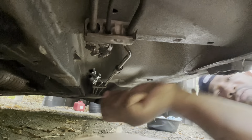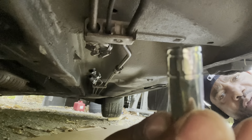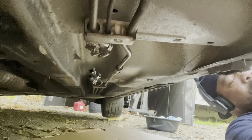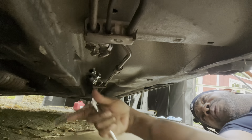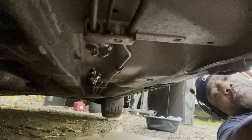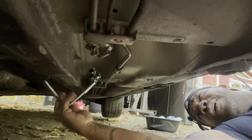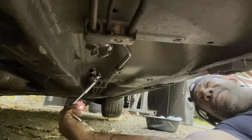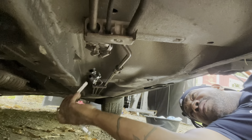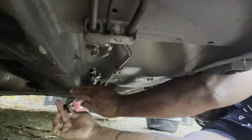All right, we figured out the screw size — these right here are 11. I'm going to put this on the ground here so I can get these off the back and slide them off. Put this fuel filter on. Like I said, if you're going to change the fuel pump I recommend you also change the fuel filter at the same time. There are a lot of bugs out here today — I should have got my power drill.